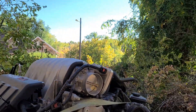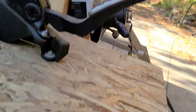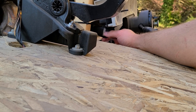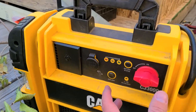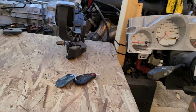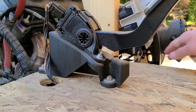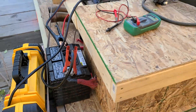That was awesome. Let's see if I whack the throttle if it opens — nope, not yet. Hold the clutch down. It may not be enough juice. We got the jumper box on it — it's maybe halfway charged, hopefully that helps. I don't know what I'm doing wrong. I heard it run last night. Maybe it's my ground situation — those jumper cables were no good. I hooked it up a little different. Let's try a third time, maybe that's the charm.